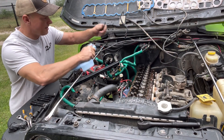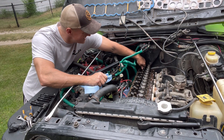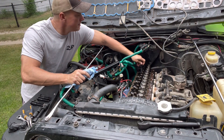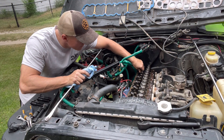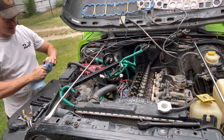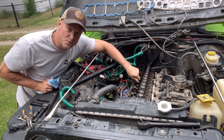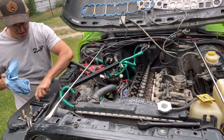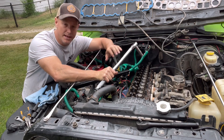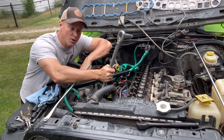Okay guys, make sure your bolts are wiped off — the grease is off of them. Okay, get them started. Hands are sore from that one. We'll fast forward through all this, you guys don't really want to see all this. Now that we're to the part of putting the head back on, head is sitting in there. Now we're going to torque it. So we're going to start out with 24 pounds of torque, starting right here in the middle.